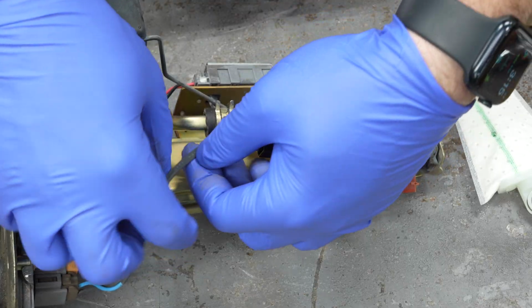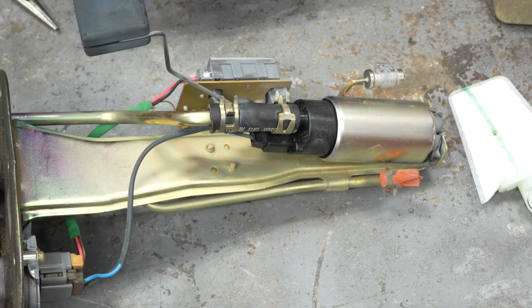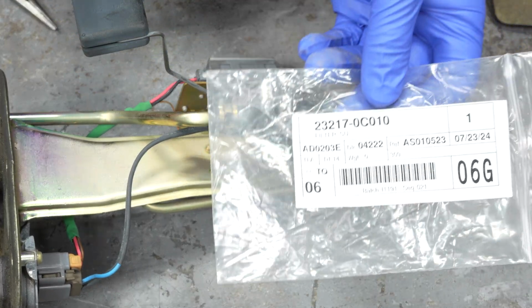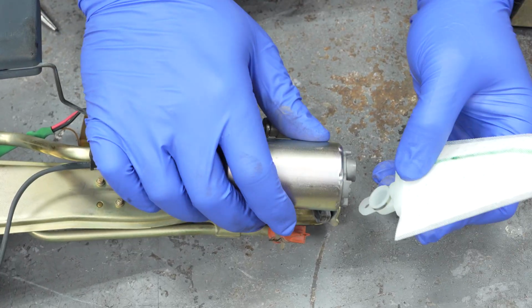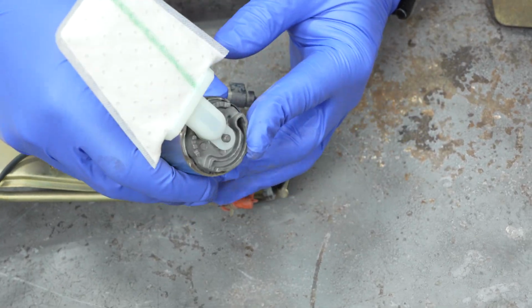Don't forget to plug it in. That's always a bummer. It only goes in the one way till you hear that nice click. And then I've got a new pickup, or strainer, however you want to call that. There is the part number for that, and the link is down below in the description. This was just from the Toyota dealer. So I was wrong, you actually have to put the strainer on first, which is fine. Just goes on like that, really easy.